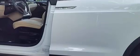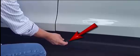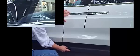It worked on the first try for us, but note that the owner's manual suggests that if it does not, reposition the key fob slightly to try again. Remember that it took several seconds for the car to recognize the fob. If new positions are unsuccessful, take the battery out of the fob and start the process over. This will become important as we start the car.